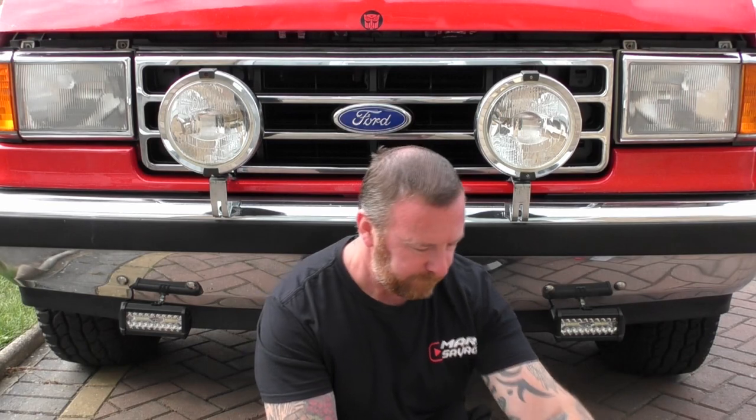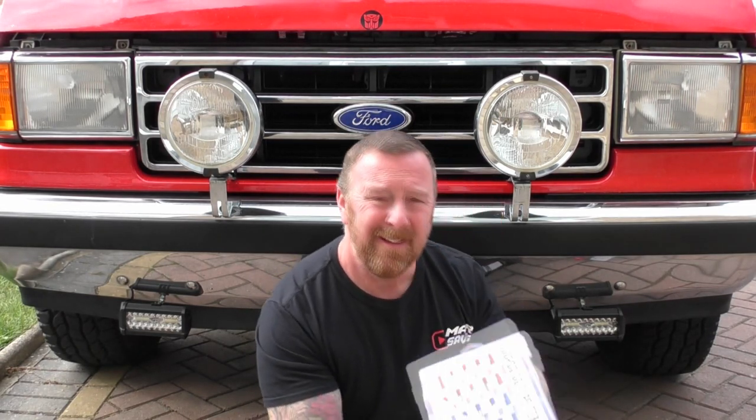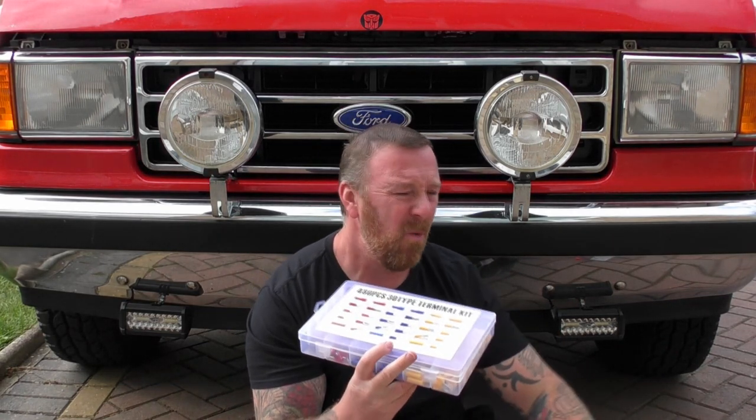You haven't got to have a huge relay or anything else that you sometimes get in wiring packs. Just make sure you fuse these. You can get little cheap fuses everywhere. Here's a good little kit — eBay, a tenner. They're going to sit in your drawer for ages until you need them. For £10 or whatever it is, really well worth it — I've used it several times. I've also got heat shrink, which is really, really clever. It stops the old tape which comes off anyway. So let's get these off, get the new ones wired in, and you can tell me what you think.